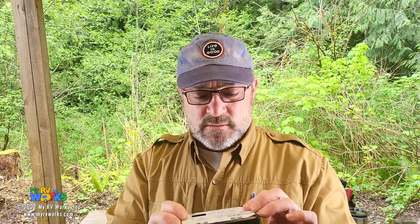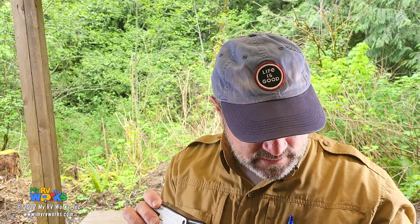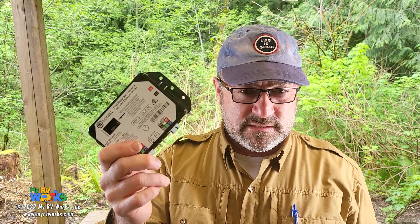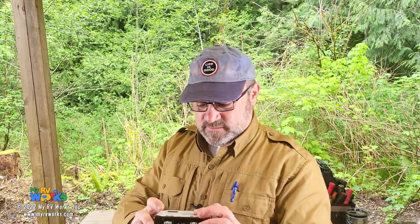How would you protect it? They do have things you can use where your power connects — you could put a choke or some kind of protection device (an MOV would be for AC). They have little chokes that you could put in if you really wanted to be that thorough about protecting these things, but the cost of some of that protection is about as much as one of these controllers. And in ten years of doing this, I've only replaced three. It doesn't mean it won't break — I may have just jinxed you.